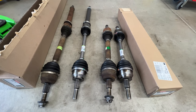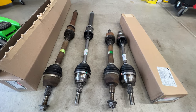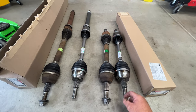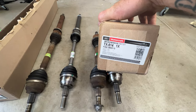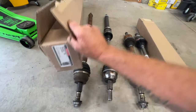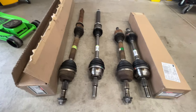Okay guys, so really quick here, as you can see, I got some new CV axles. Probably could have reused these, but I figured while I'm already in there, just go ahead and change them out. I noticed a little grease on this one, so the boot was probably on its way out. I went with the genuine Motorcraft. Got these off Amazon. There's the part number for that one, TX-814. That's going to be the driver's side one. And then the passenger side one is TX-812. I got both these off Amazon. I'll put a link in the description for them.